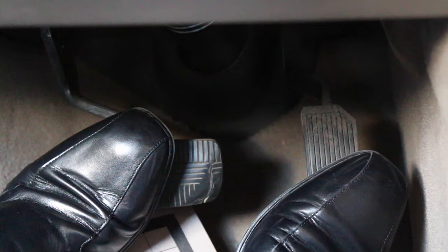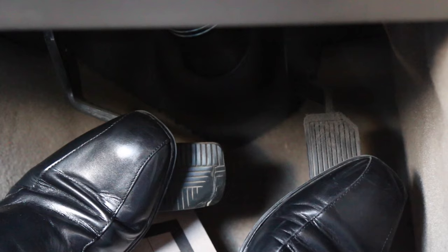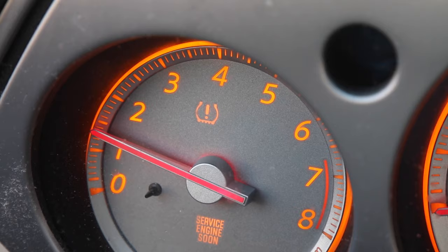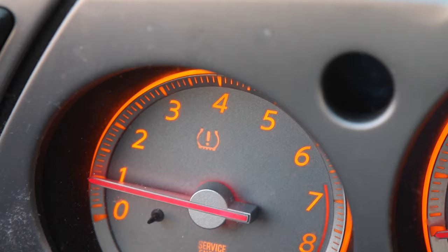I'm just going to test drive real quick to see if we can get it to reproduce the symptom and get an overall idea about the drive and feel. On the test drive we're particularly looking for any hesitation or stalling. This one's got about 119,000 miles. You can also power brake the vehicle — put it in drive, left foot on the brake, ease with your right foot, give it a little bit of gas, get it to about 1500 RPM, hold it and see if you can get any hesitation in the engine. I don't feel anything right now, so we're going to take it back into the garage.